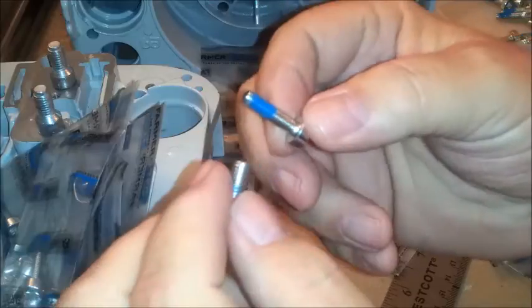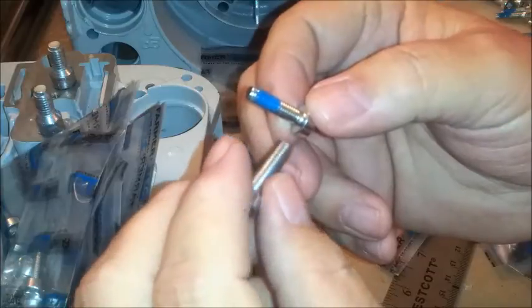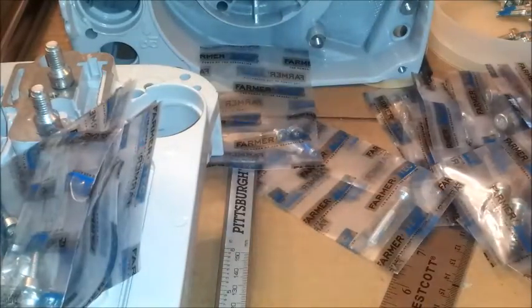This blue — that's called microencapsulation, and that's where they put the Loctite; it's pre-treated for you. This screw was bought separately, didn't come in a kit, so I've got to pre-treat that one. But I want you to see the difference — that is a really important aspect of them.